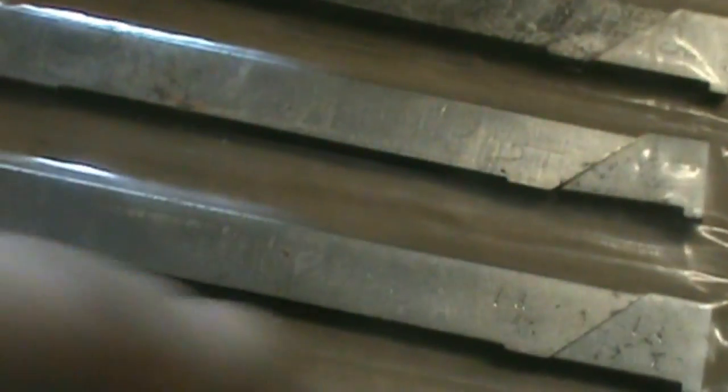Alright, so I washed those off one more time in the Varsol, so they're pretty much all good to go. I'm just going to let them dry, but right now I'm going to get the Apex seals. What I need the crazy glue for is, you can see these are a two-piece seal. If you remember, on my other ones, hold on a second. Yeah, on my other ones they're the three-piece seal. Remember they had that split right down the center, but these are the two-piece, like an upgraded version. They come in two pieces, with one little small corner piece and then the long Apex seal.